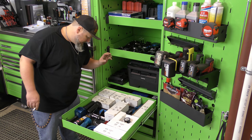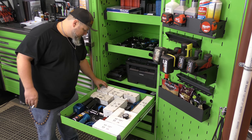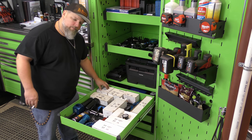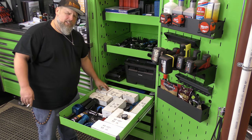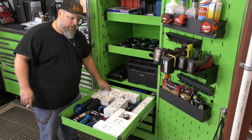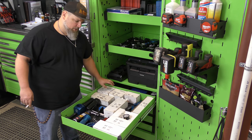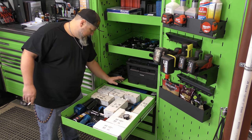This is a big twin main shaft bearing race tool. Jim's master cylinder bleeding kit comes with five or six caps for the different master cylinders that Harleys have used — it allows you to bleed the brake system pretty quickly. There's another approach to this as well and I have both — I'll show you that later.